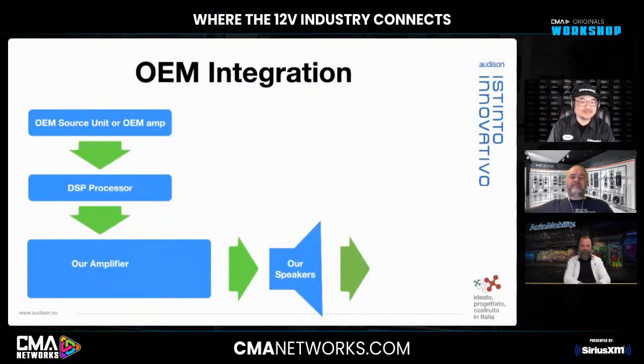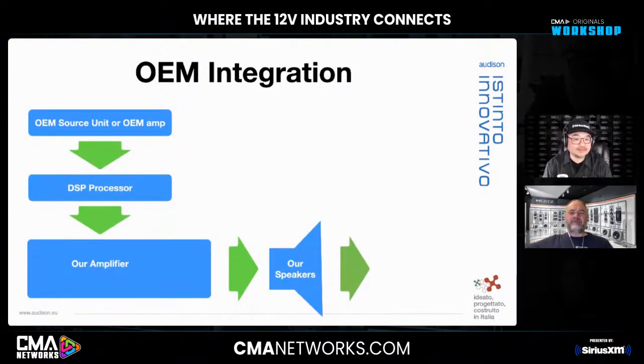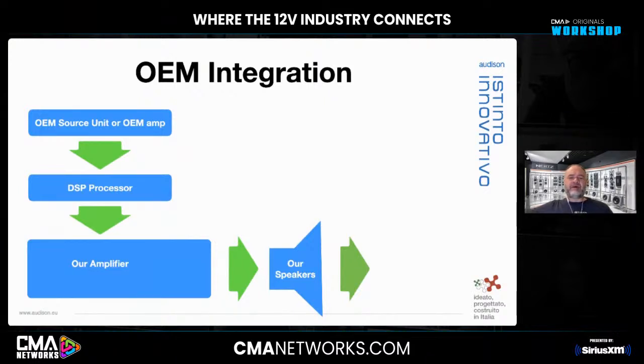All right. Well, the first thing that I want to talk about is the concept behind the BitTune, because a lot of people may have been exposed to it sometime over the past 9 years in one of its previous versions. Basically, a BitTune is a high-end USB sound card that has two channels and a lot of hardware attached to the outside. When we originally launched the BitTune, it did a lot of things. One big focus was that it can test the distance to the speakers and enter them into our DSP processors. It could also automatically equalize our DSP processors after that to whatever target curve you selected.